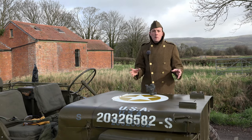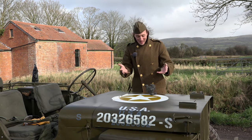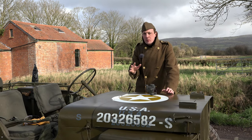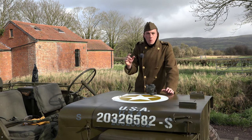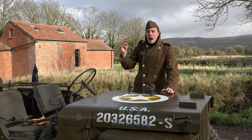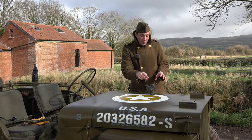So how do I feel overall? If the WO is 100% of carburetor performance, the economy version Solex is about 85% of a WO — it feels exactly the same, just a little more muted. The accelerator-pump version of the Solex is 105 to 110% of a WO — a little bit more power on occasion — and generally behaves very very well.